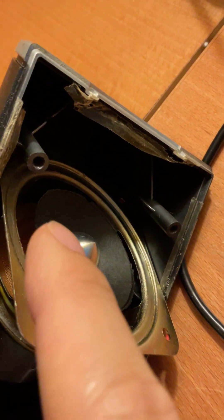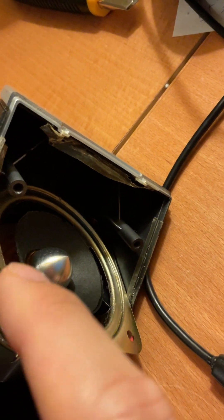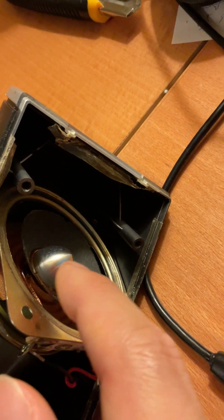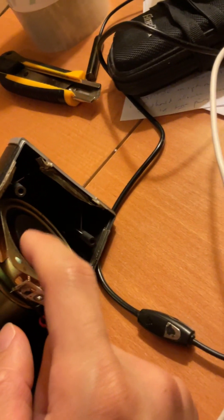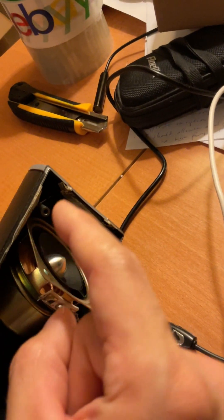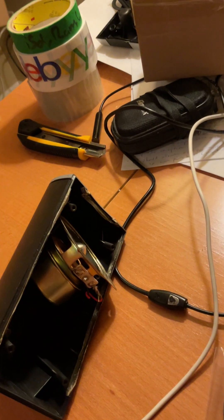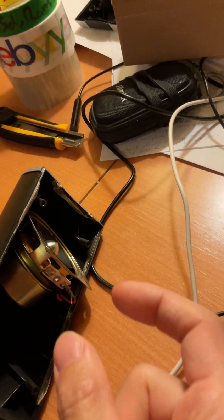You want to make sure that the measurements — the width between the inner lip, right outside of the lip, and the total diameter — all match up as closely as possible. You can either take the old gasket or visualize where the ridge and bump is going to go. By making sure you have almost exactly the right gasket size, you'll ensure that when this speaker plays in concert with the undamaged speaker on the other side, it's going to sound similar to how it was when it left the factory.